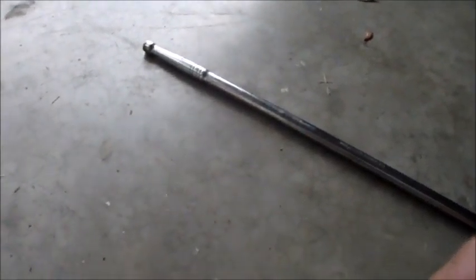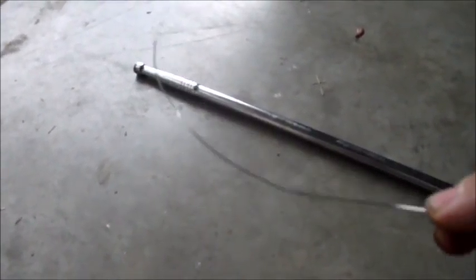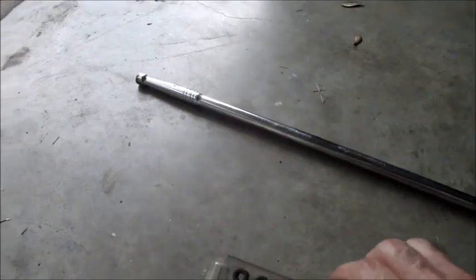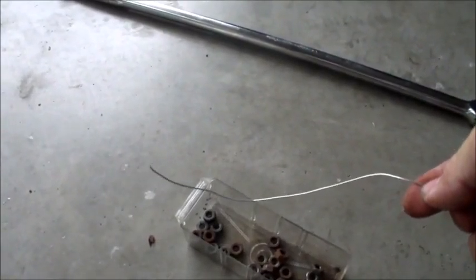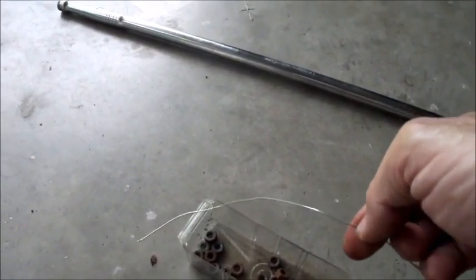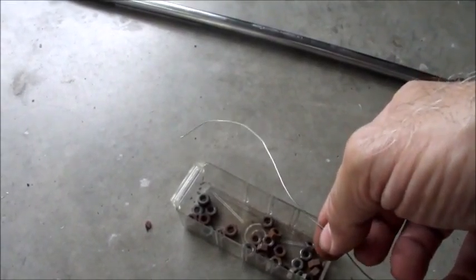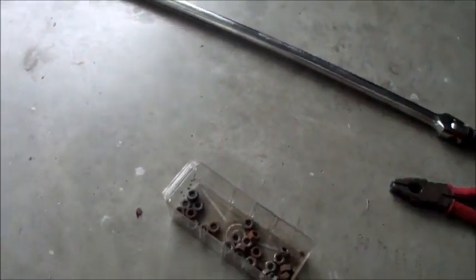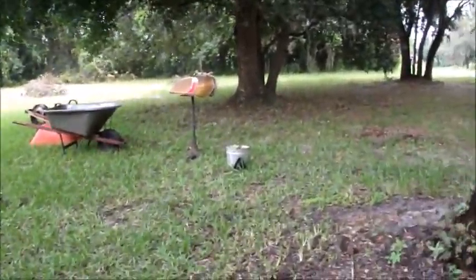I just took a couple pieces of wire and stranded some nuts on the wire, just like that. Made a couple of these and threw them in the tank, so when I shake them, they'll knock loose any rust scales that are left in there. Anyway, time to start stripping it and go from there.